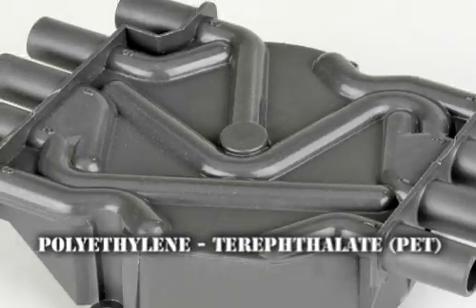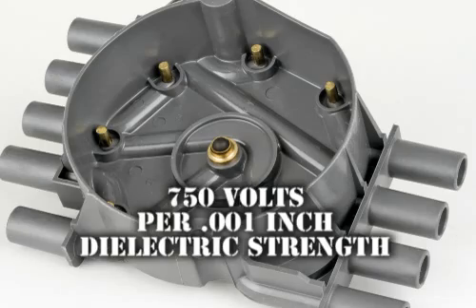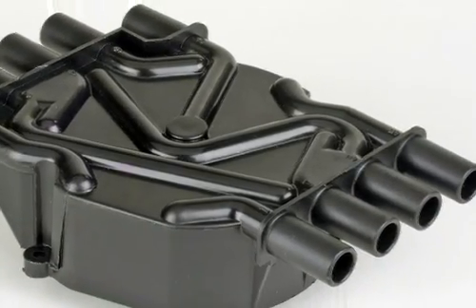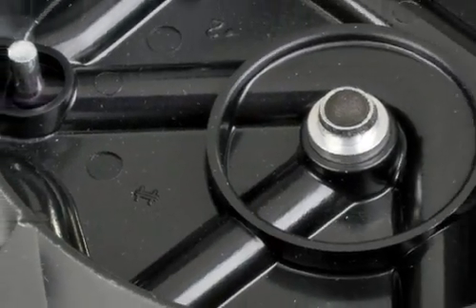Wells also utilizes a high-grade PET plastic, which has a dielectric strength of 750 volts per thousandth inch. This plastic must be a superior grade — it is the only barrier between the high-voltage carrying wires inside the cap.